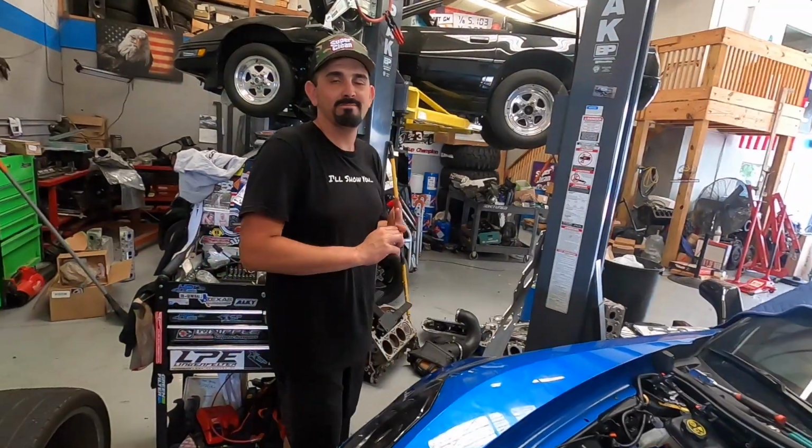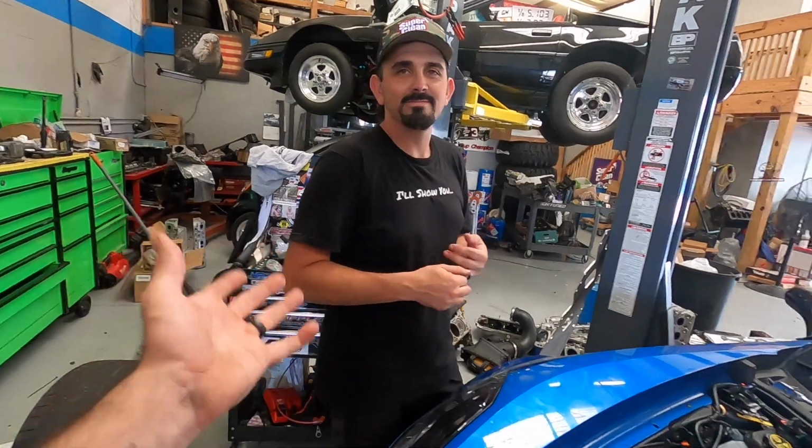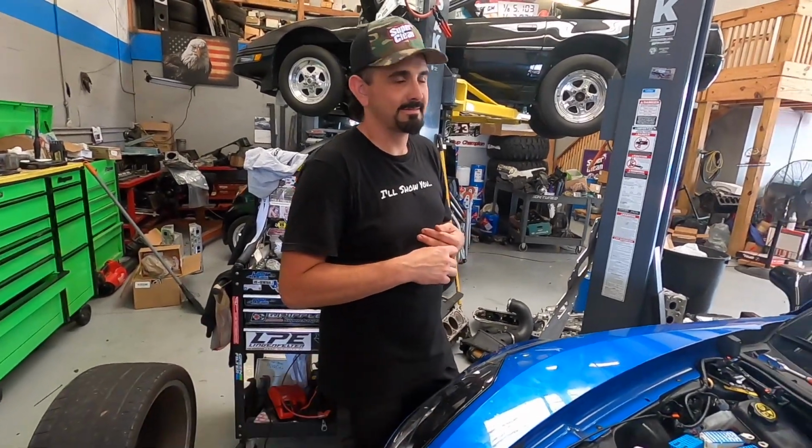One thing that we want to note is that as the engine flows better and better, boost is a measure of a restriction. So what we're doing, putting a ported cylinder head in there, is going to allow it to flow more, and it will have less of a buildup of restriction. So you're going to drop boost. In other words, if you put a camshaft in there, you put headers on it, it's going to drop boost. However, the engine is gaining efficiency. So what we're trying to do is run that blower harder, proportionally adding more airflow with how much easier we're flowing air, really.